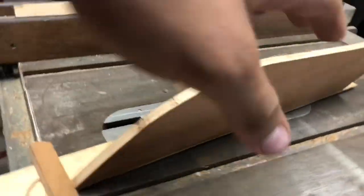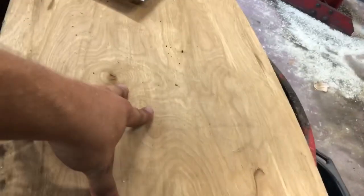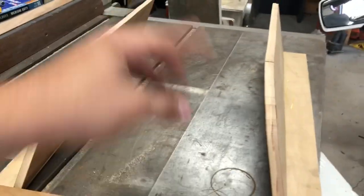to that point. What I have to do first is get the film on, which is actually the same thing that is used on the side of that motorhome. It's like a fiberglass film that's very flexible, but it's a super smooth and glossy surface. So we have to line this, cut it to shape. Then we have to line this 1/8 inch piece with it as well, just contact cement, and stretch that piece over, and staple and glue the edges.